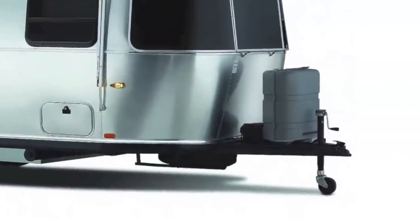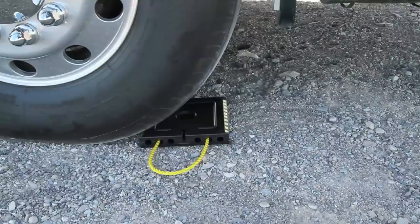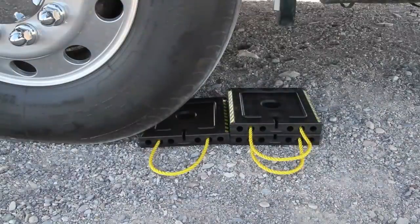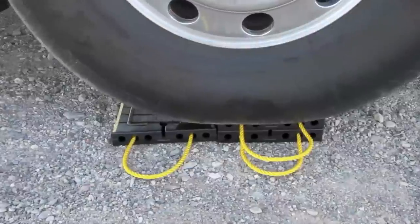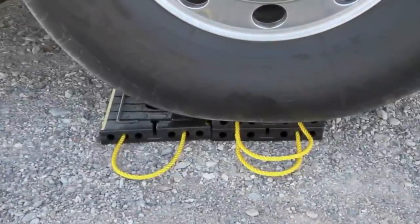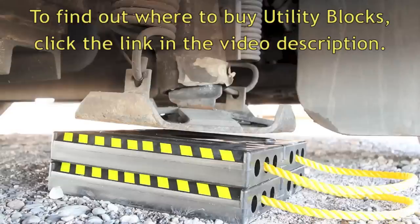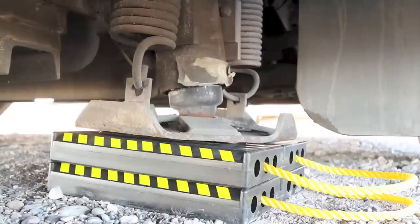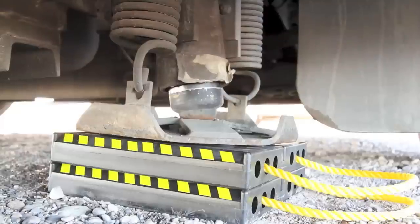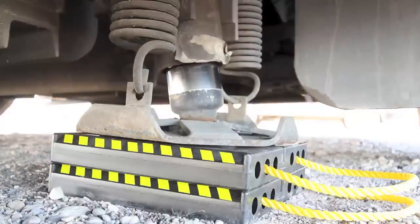It's a clever way to hold the wheel in place while preventing it from sinking into soft ground. If you level your RV by driving up onto the blocks, you can roll onto a single block or stack them higher as needed. Utility blocks can handle the weight of our large motorhome with ease, and they can't slip off each other because the raised ridge top and recessed groove bottom nest together securely under the weight of the RV. If you regularly park a heavy motorhome on very soft surfaces, you might need to spring for jack pads with an even larger surface area. But those pads can be a lot heavier and are generally much more expensive, typically costing two, three, or even four to five times as much.